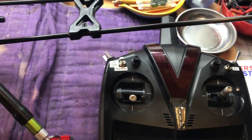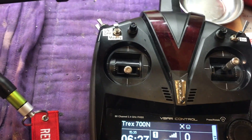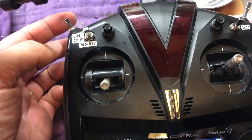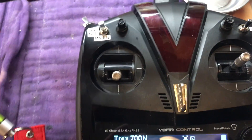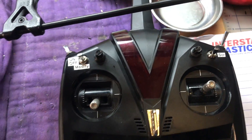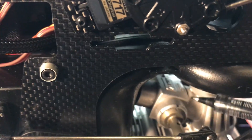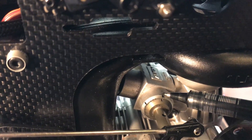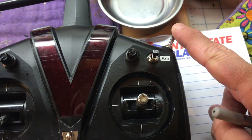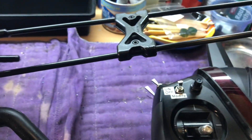It did work for the first couple of gallons on this helicopter. Normally what you'd have set is flight mode one as direct throttle, then bank two, bank three, and bank one mostly running your head speeds. I've already put some tick marks on the carb barrel — there's my idle mark, and when I hit my throttle cut switch, it closes the barrel completely and turns off the engine.